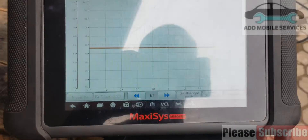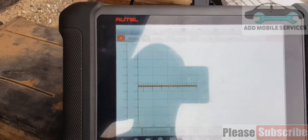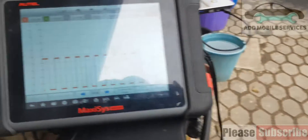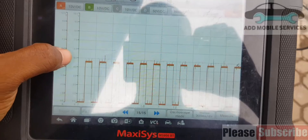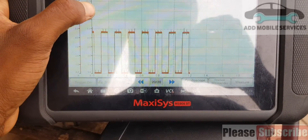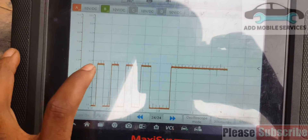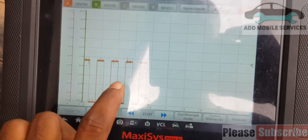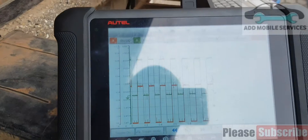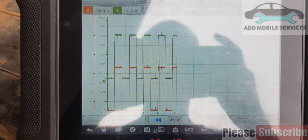I'm getting almost 5 volts. I will start the vehicle and drive. The vehicle is running. I'll put it in drive and see if the issue is fixed. When I put it in drive, you see the square wave — this is the square wave that I am generating. Whenever we hit stop, it stops. I just lifted one tire up so that I can drive it. When we put it in drive, it works. The square waves are coming.